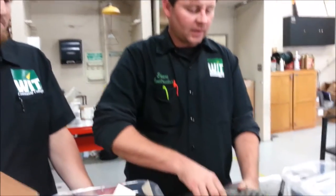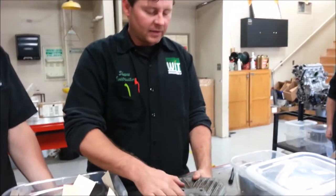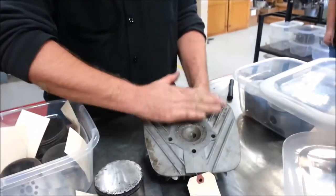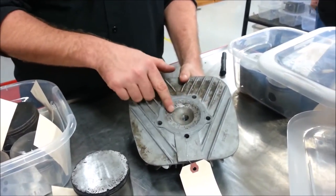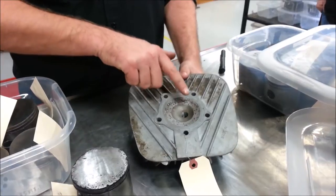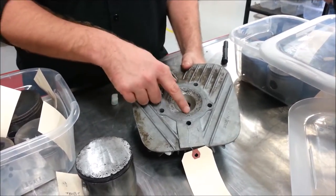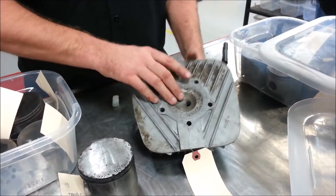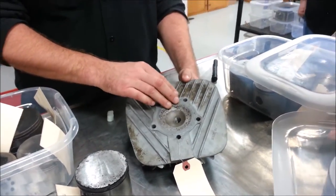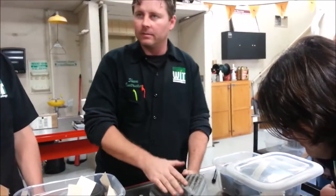Exactly. Basically there are a bunch of different ways we could rob Peter to pay Paul. Another thing I could do is grind this out and then mill this surface off, shrinking it back down. But there's a lot of math involved in that — it's going to take a machinist. By the time you send this to a machine shop, what's your labor worth to try and grind all those marks out and machine this back down? Pretty soon you're going to be in the cost of a replacement head. You have to replace the head and just be done with it — be OEM original and good to go.